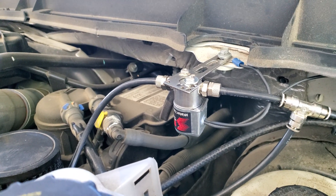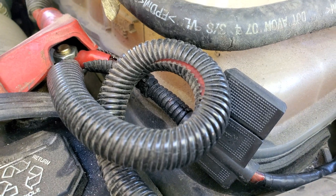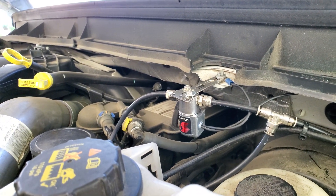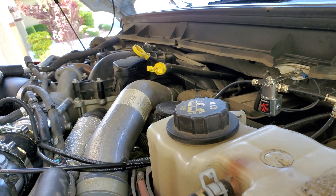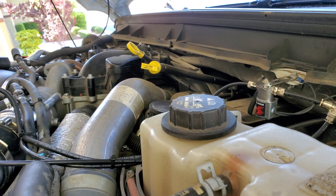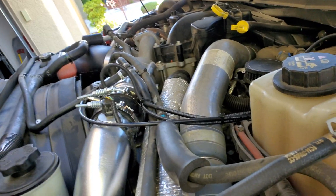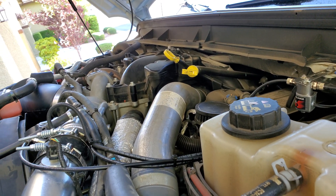I didn't have to buy the expensive kit and not use the included tank that would've been $120 to $140 if bought alone. The inline fuse I had laying around is only 20 amps — all it requires. The pump is rated to about 6 amps and the solenoid can't be more than 1.5 amps. After having this kit on here for only a couple of weeks, it's night and day difference when the methanol is spraying versus not — even at part throttle getting on the freeway or accelerating to pass someone.